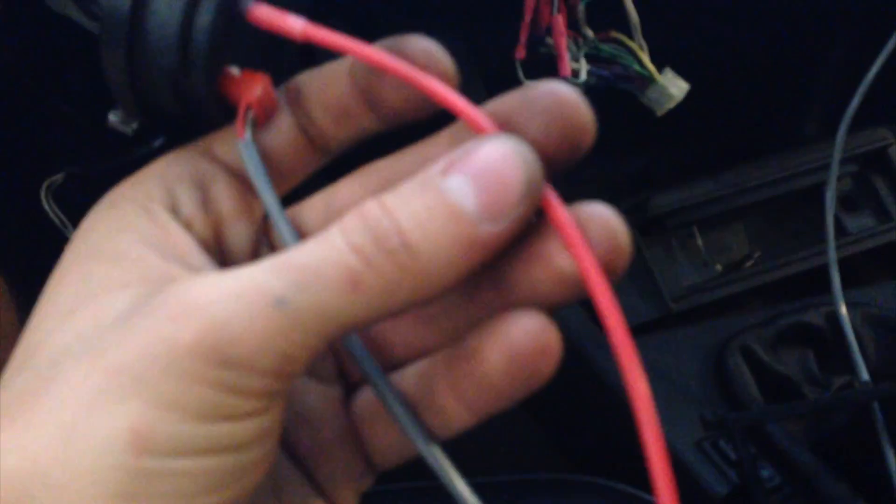This is just a laser cut piece of plastic that goes in where the onboard computer was. You just remove the onboard computer — four screws in the back, pull that out — and run all your boost gauge through it. This is my APSX boost gauge. You can see the boost line, the power cables — that all runs down to the power, the 12 volt, the digital from the readout. You can have this individual unit without the APSX wideband, and you can have the wideband without the boost gauge.